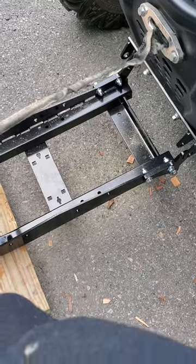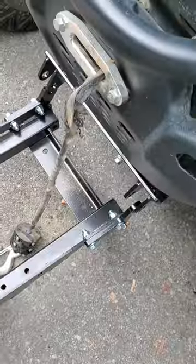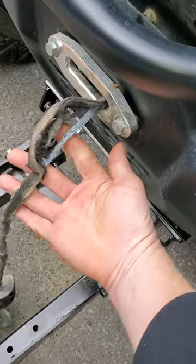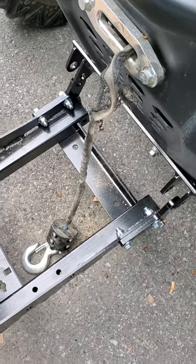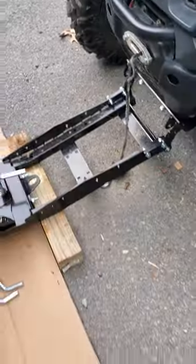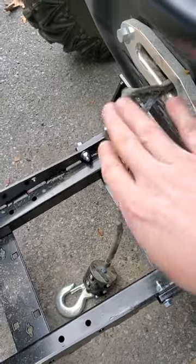Also, take off your cable — because after just one pull, this is what it did. So this is coming off right now and a plow strap is going on instead. Let's get ready for the snow. Good tip: get rid of the cable guide and put a roller fairlead on.